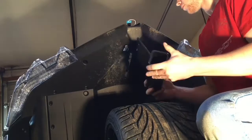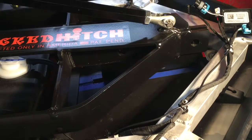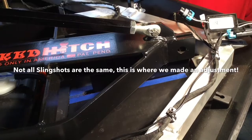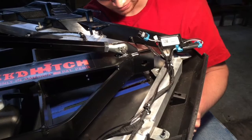I'm going to slide the receiver up into position through that underbody panel. He's got it in position but he's going to have to slide it back to get those holes lined up. We've got to cut the slot bigger — you can see where it's rubbing right there. We're actually going to have to cut that slot just a little bit bigger for some odd reason, almost all the way to the aluminum.